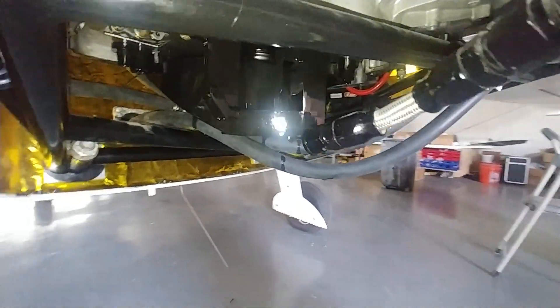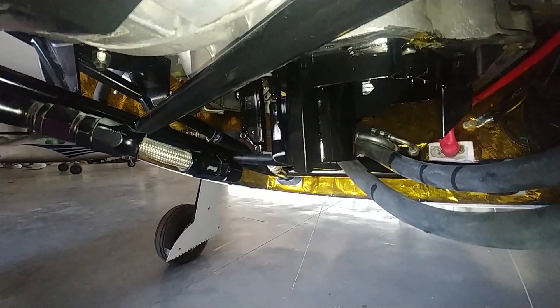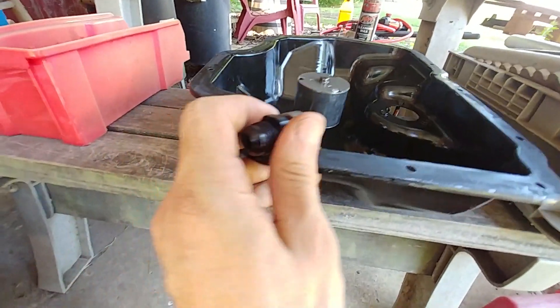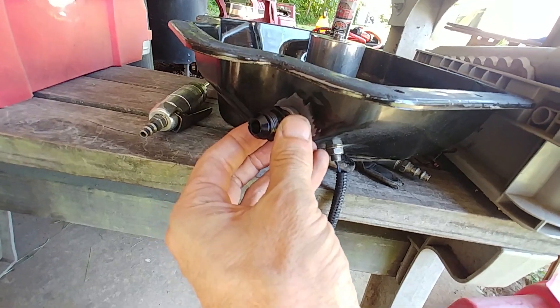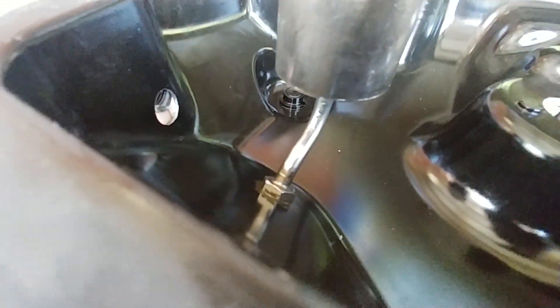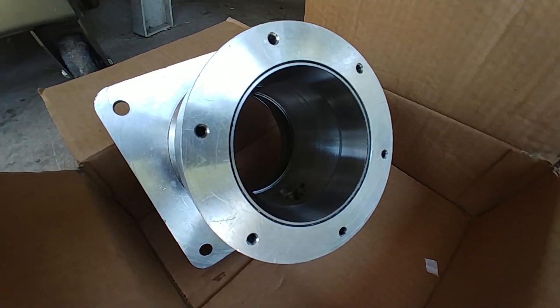So that's the first job — for Brit to weld up that bung. Another job for him is to weld up those other holes. Here we are up at Brit's place now — there's the new weld bung, I've angled it already, and Brit drilled the hole for me. This is how it's going to sit, with a slight downslope so it feeds in there nicely. There's the old one over there also with a downslope, and this one has a larger hole because it's running a 3/8-inch NPT while the other was a quarter-inch NPT.